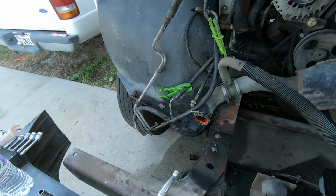So we've got motor mount, and this right here, that has gotta just come out somehow. I've replaced that before. I just don't remember if I did it from the bottom or from the top. All the bolts except for that one's out. And even the bolts on the torque converter are undone at this point. So it's ready to come out. I'm gonna do that tonight before it gets dark and call this one very long day. Well done. So let's get that out and then I can say that.